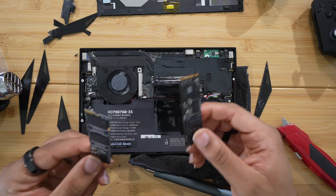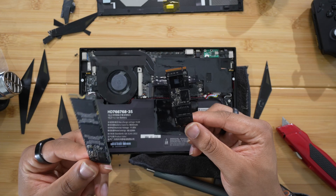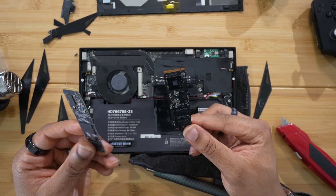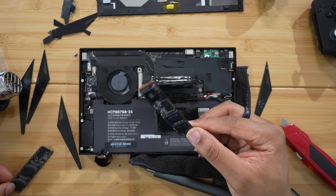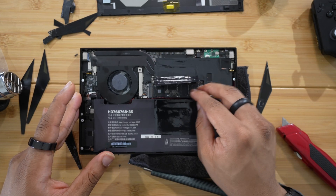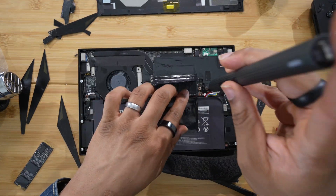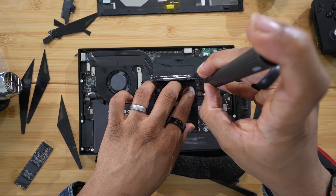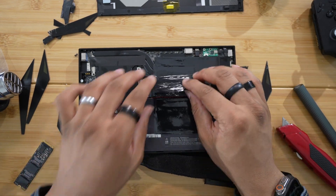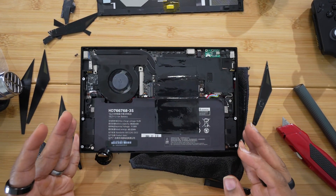I'm not going to go through the full procedure of upgrading the SSD — I did the cloning and I'll leave a link to the cloning tool I use in the description. You're just going to clone the SSD as you usually would, or you can start fresh. I always clone mine so I don't have to start over. Then put the new SSD inside, make sure you put in the screw, and you're going to want to make sure that you put that thermal tape back down.